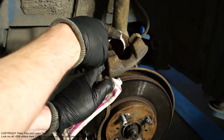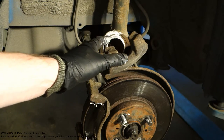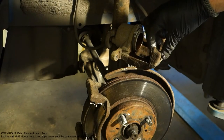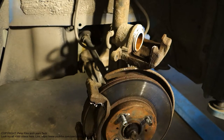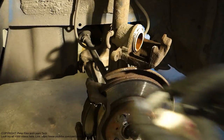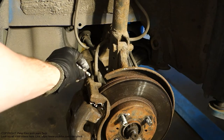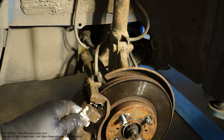There is actually a slightly better rubber lubrication, but if we insert a little bit of grease in there, it is not bad. And then the other side, in this area, I can insert this lubrication. Okay, good. And next, I have these bolts that keep the brake caliper in position, and these parts go in here. They are also good to lubricate in that way.